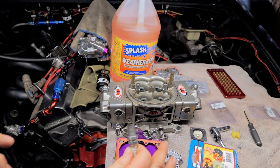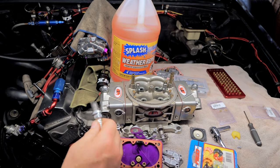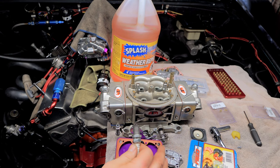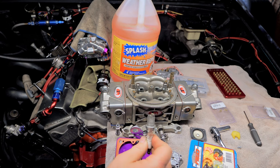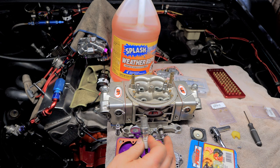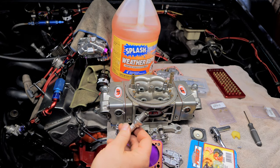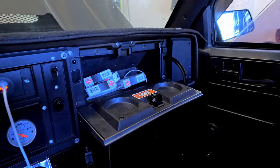So now I'm gonna show you what to look for, because we're gonna do some full rips in my vehicle to show you what you need to look for fueling to make sure everything's okay and it's not gonna hurt it. You do not wanna rely completely on your wideband for this. The wideband is just a tool that you're gonna use to make sure you're not gonna hurt anything, but your plugs are gonna be the tell all, end all, even for your cruising and for your wide open throttle pulls.